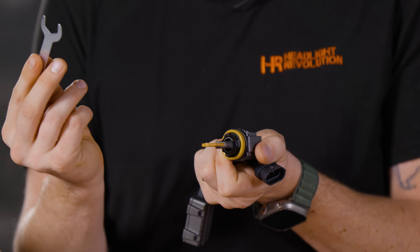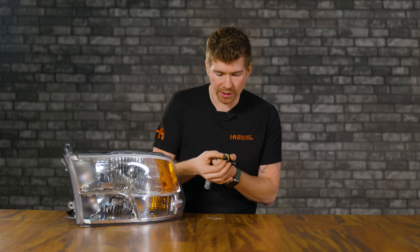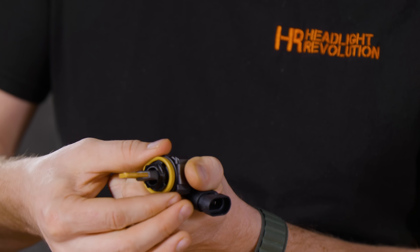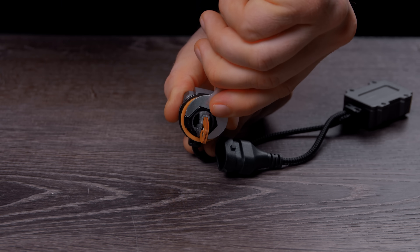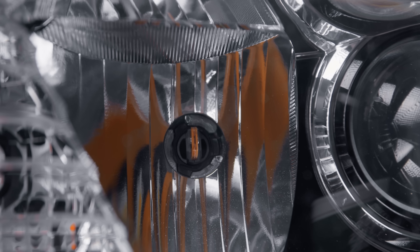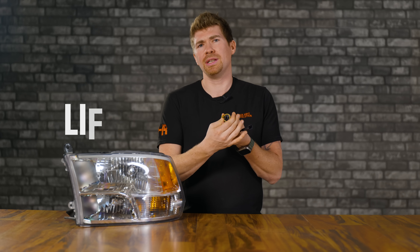You want it set and then forget it — never have to worry about the bulb again. One of the biggest major improvements of the new 4.0 is that Morimoto changed how it's adjusted. On most sizes it comes with a little wrench. You take that wrench and turn it counterclockwise to loosen, which allows you to spin the collar. When it's in the housing, you can set it just perfect and then tighten it back down. It might take some trial and error — just make sure it's upright inside your housing so you don't scatter light and blind oncoming drivers. This does have a lifetime warranty — that's another win from Morimoto.